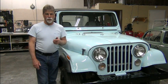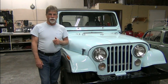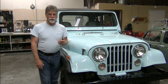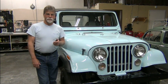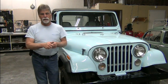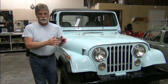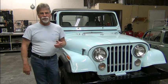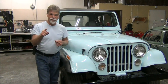The guy that historically does that for us has left the building. We don't know where he is, how to get a hold of him. So we came up with a way to do it ourselves, and we balanced the coupler, the flywheel, and the clutch. We're all statically balanced and then checked dynamically, because I thought I was going to static balance it first, get a little closer, then dynamic balance it. Turned out I got it so good doing it statically, we spun it up nice and smooth. And of course, there's a video of that also.